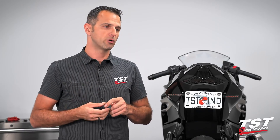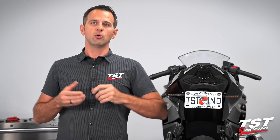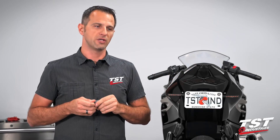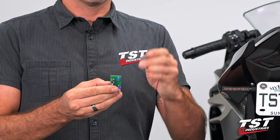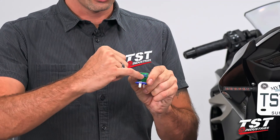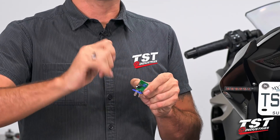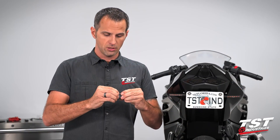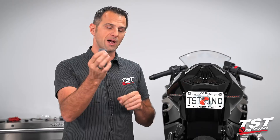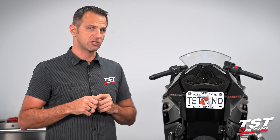This is a plug and play component. It fits right under the front fairing here. We'll show you exactly how to do that in this video, and we'll also show you how to adjust this — because once you slip this cover off, you can adjust the flash rate by accessing this little potentiometer. Turning it clockwise versus counterclockwise will enable you to change the flash rate, and then you just snap it back together, put it back on the frame, and you're good to go. It's a very simple installation.